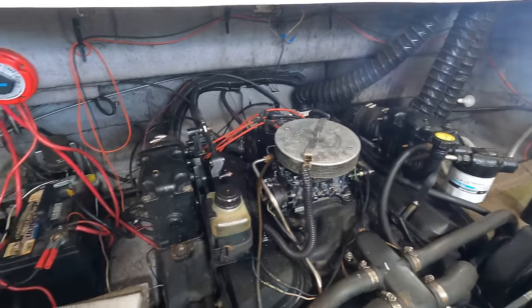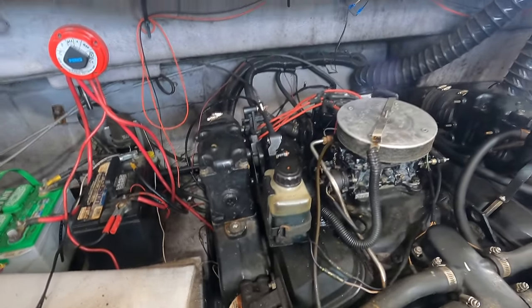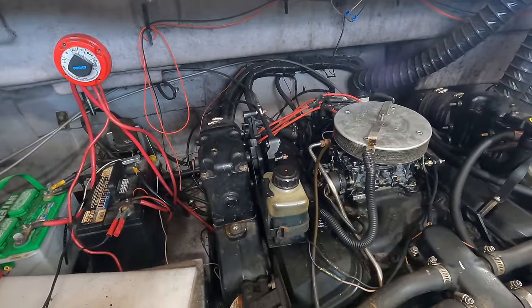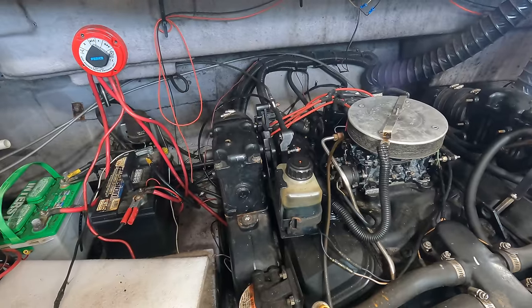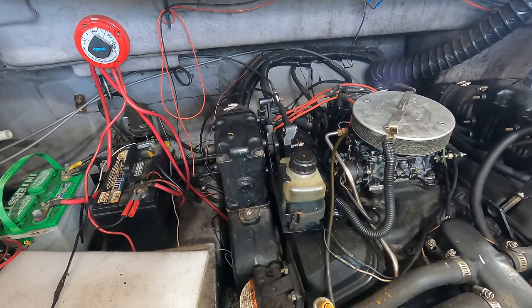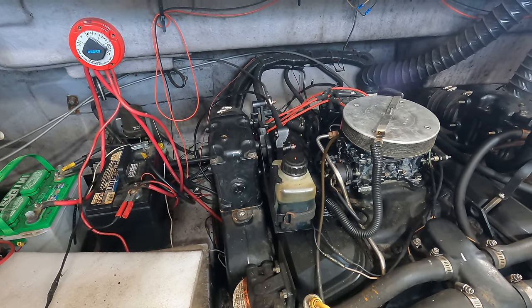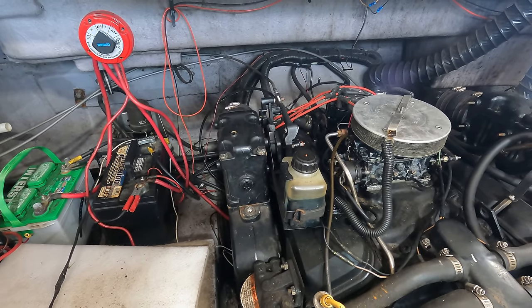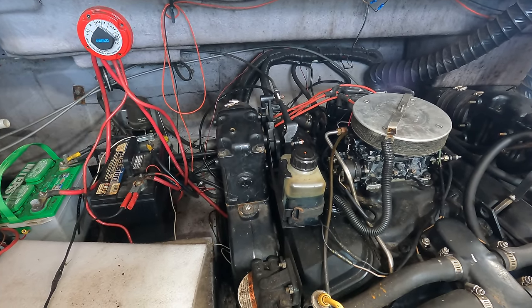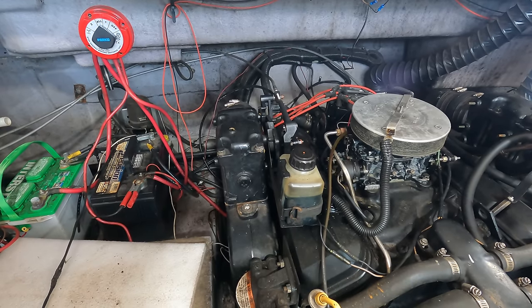The other major possibility are the exhaust manifolds. The exhaust on a boat gets ejected out through the hull, and that actually requires a little more engineering than you might initially think. Exhaust on a car is no big deal. You run it through a pipe and exhaust it out the back, out the top, whatever. But on a boat, if you're going through the hull, you need a seal or your boat leaks. So to take the exhaust through the hull, you have to cool it first.